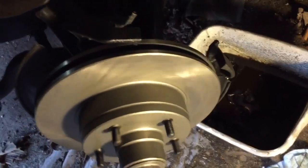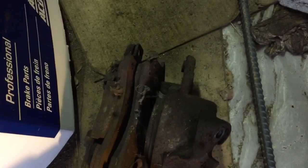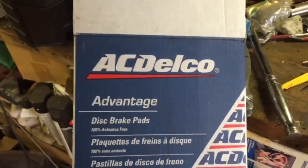I got the rotors on there, got them mounted up, and I'm getting ready to lay out the stuff for doing the brakes and putting the pads on. I pulled the master cylinder off — you got the two lines, two nuts, and the bracket on top. I want to try to blow the lines out, but first I'm laying out my stuff: I got my caliper, I got my flex line. When you look at the brake pads you can see there's one pad of each type, so I opened the new pads up — AC Delco parts.